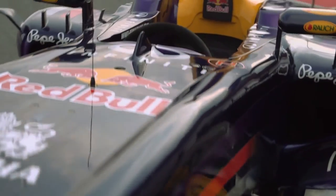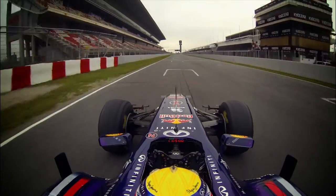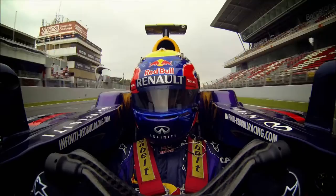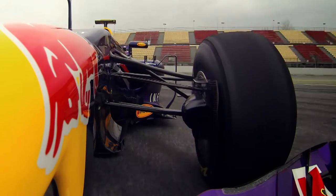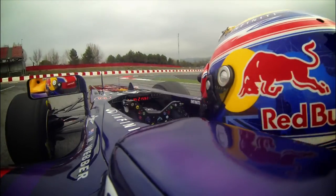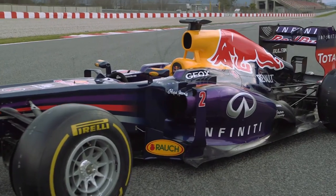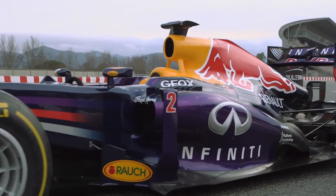In terms of percentages, it's really difficult to say how much of an F1 car is made up of carbon, but actually all of the bodywork — every part of the car that you can see — is carbon fibre. The steering wheel is bespokely made to the driver's requirements, all out of composites. All the suspension, all the bodywork. The chassis, the survival cell that the driver sits within, is all composite, as is the gearbox. Now the majority of teams are using composite carbon fibre gearboxes, so it's had a huge impact on the sport.